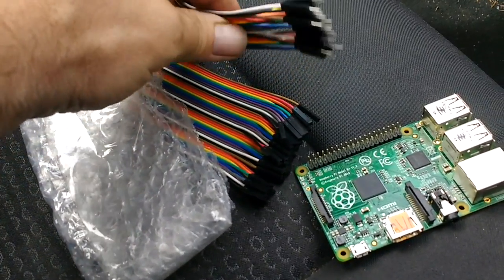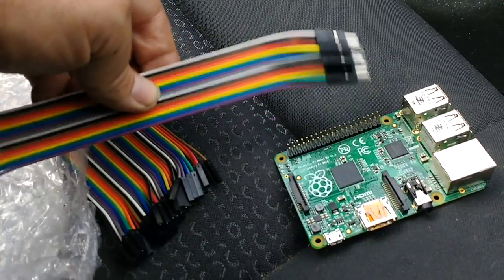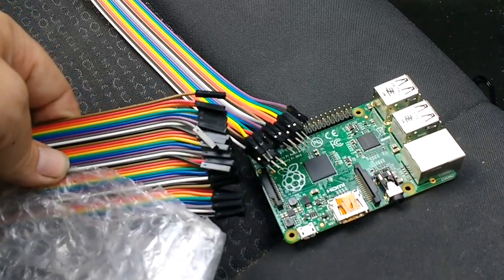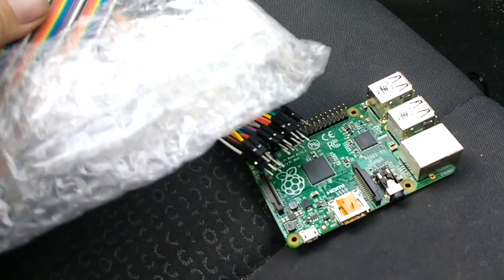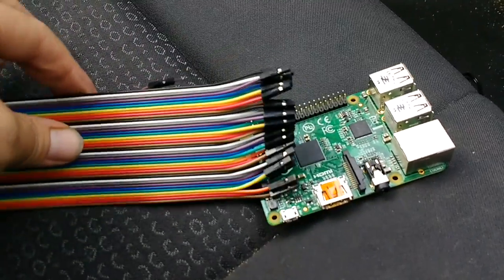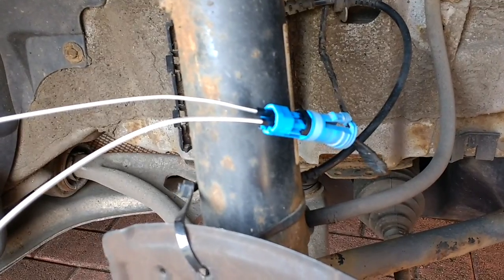The way I pinned this out — I've shown this in other videos — this is a Raspberry Pi mini computer, and from the GPIO pins you get these leads. These are perfect for connecting into Bosch and AMP pin configurations; they fit snugly and you can get them off Amazon or eBay for pennies. They're great for making up test leads.